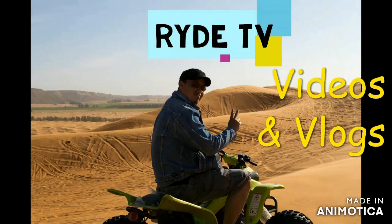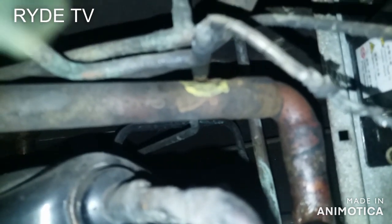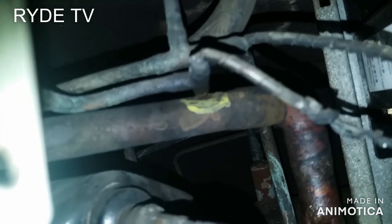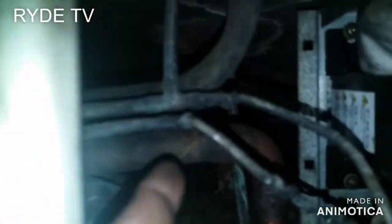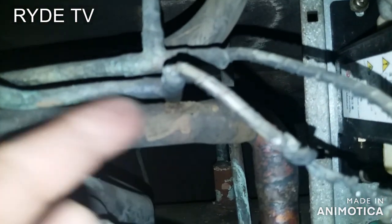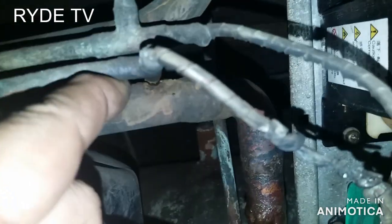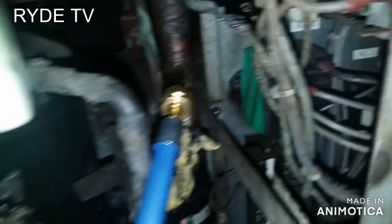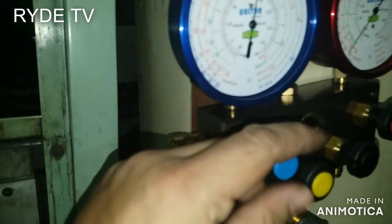If you like this video please give it a thumbs up. As for the inspection, the refrigerant leakage came from two copper tubes rubbing against each other and making friction because of frequent vibration, and also because of the rusted base of the compressor. That's why the base gave in, and the copper tubes attached to the compressor ended up rubbing each other, making holes and leaking.